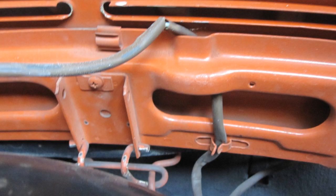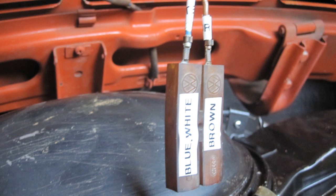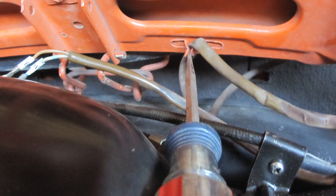Note the routing of the tag light wire and the wire colors to the connector. Label the brown, blue, and white wires as shown, then disconnect the connector. Pry open the wire clip with a screwdriver, being careful not to pinch the wire, then pull the wire out from the lid.